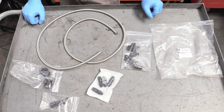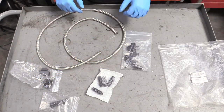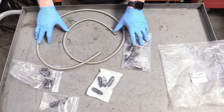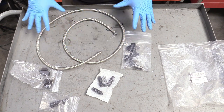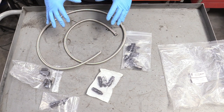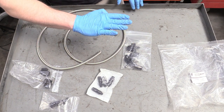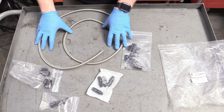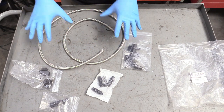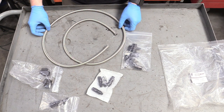So now we can move on to our four corner steam kit. Here is our Summit Racing provided part number with a link down below in the description. These steam kits are absolutely essential for LS engines because the thermostat is located lower than the heads — you need a way for air to get out of there. If you don't, you'll create hot spots, overheating, and there could be pre-detonation issues. If your engine is angled up a little bit in a classic car, you can get away with a two corner kit. But if you have a level engine setup, you need a four corner kit — I recommend just getting the four corner kit no matter what.